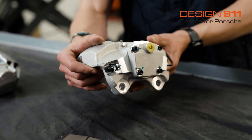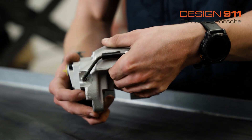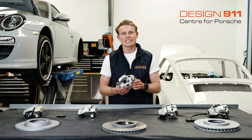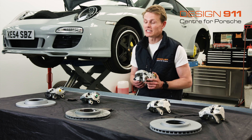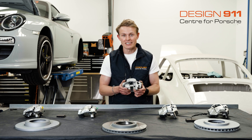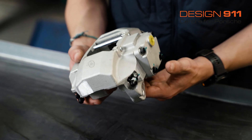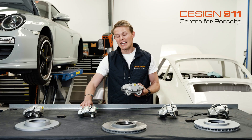The big upgrade in Porsche's brakes came in 1969 with the introduction of the S caliper, used on the B-series of Porsche. The S caliper was manufactured specifically for Porsche by the ATE company. S stands for Schwer, which is German for heavy duty. Don't be fooled by the name — they weren't in fact heavy; they were the opposite. These calipers were made out of billet aluminium and weighed approximately 3.4 pounds, which is equal to one and a half kilos lighter than the M-type caliper.